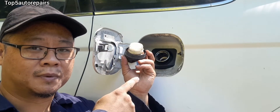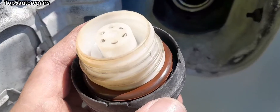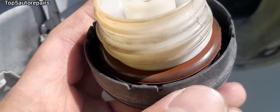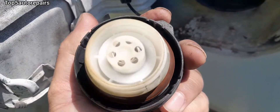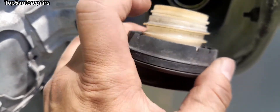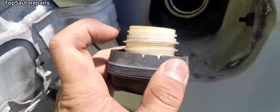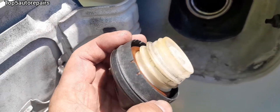The first and most likely problem is you probably got a bad gas cap. First inspect the gas cap seal — if the seal is cracked or torn, go ahead and replace the gas cap. Next inspect the plastic thread on the gas cap; if the thread is worn, this will definitely trigger the P0440 code.